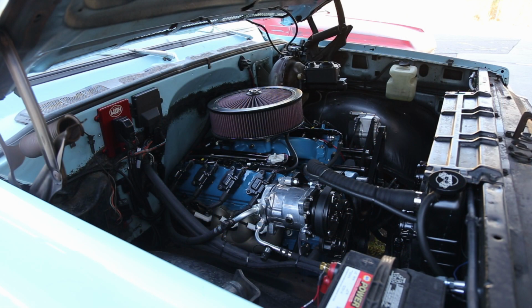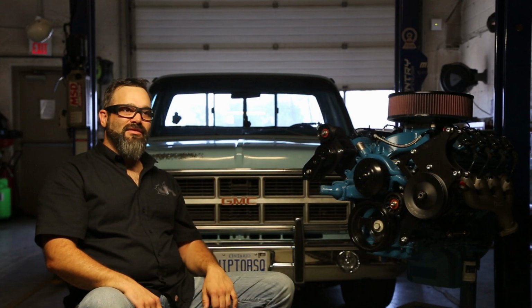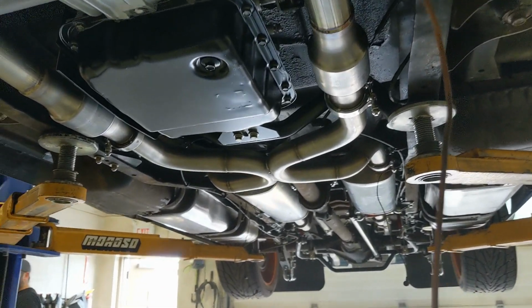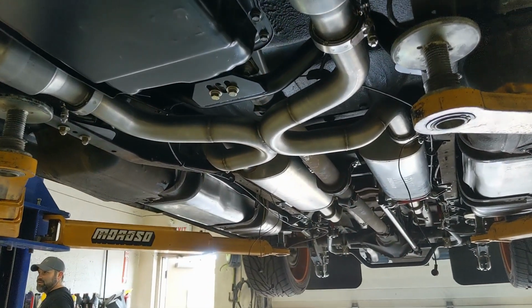So that's it. All right, along with the engine upgrade that we're going to do in the truck, there's a lot of add-on companies that were working with us. We've got DeWitt's Radiator out of Michigan. They have an LS swap Squarebody rad that we're going to be using in the truck. They helped us with the electric fan setup on it. Keeps everything cooling the way that you should for an LS engine. It gets rid of the old radiator that could be clogged, too few rows to run it properly. We just want to make sure that this goes off without a hiccup. We're on a bit of a time constraint to get it all done.